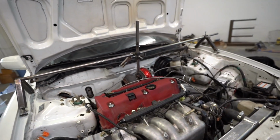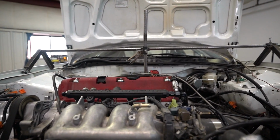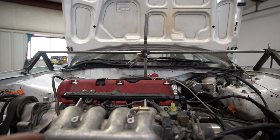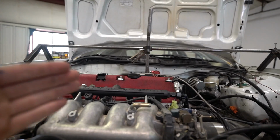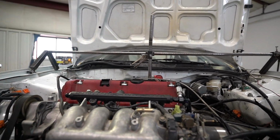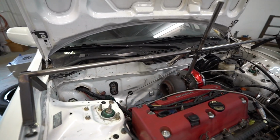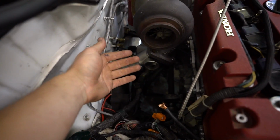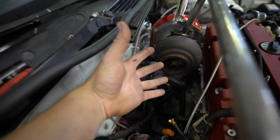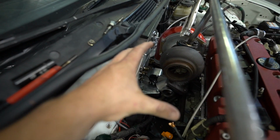And then there's still room here where the hood goes. As you can see, it's kind of deceiving, but it has a lot of room back there to go up. So I just left a little bit of room. That way if someone puts an S369 on there, hopefully it will still fit the compressor cover. What I'll probably do is go borrow one from Brent and see if it fits once I get these runners tacked up. But I'm gonna go ahead and tack up one runner. I've already got it kind of figured out, so I'm gonna tack it up, and then I can pull this all off and run the other runners on the table and not actually have to have all this in there.